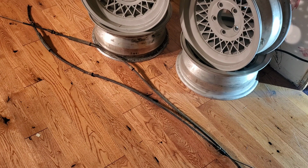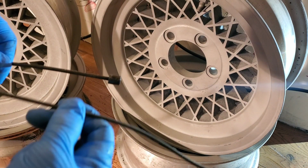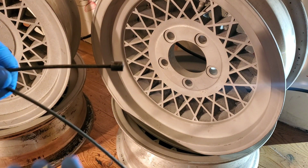Under the car, the stock Mustang cables could not join up with the calipers, and the Lincoln cables couldn't join up with the equalizer bar. So rather than having custom cables made, it seemed like a little improvisational ingenuity was in order. I was able to marry the Mustang cable to the Lincoln cable by installing a cable clamp in between the two.